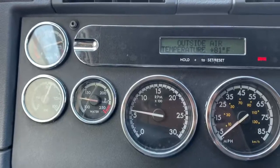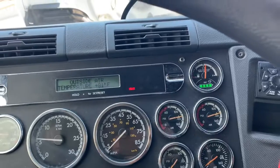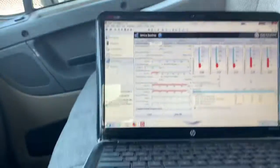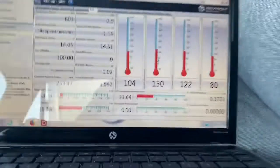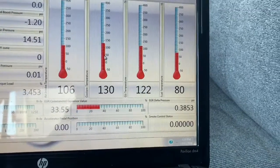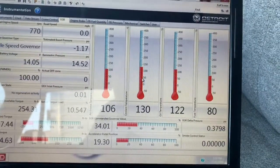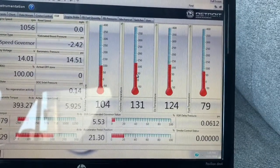As of right now we started up the engine. We're at about 125 degrees and we're going to stay here and try to warm it up even more. If we go over to our instrumentation and go to our EGR, you can see what it's commanding and what the PSI is — it's 0.37, 0.36 thereabouts. I'm at about 500-600 RPMs right now.